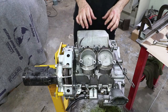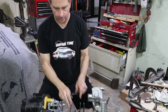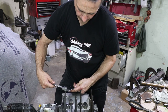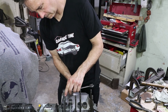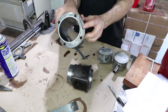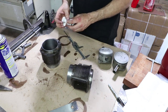This side right here is slightly high, so I have to take this all apart and determine why. I noticed one cylinder was hard to get on and off — I found out one of the head studs was a little bent, so I'm replacing it with an extra one I had, and that might help it sit flatter. This cylinder also has a broken fin and I did not do that torquing the bolts — this is how I found it. It probably got dinged when the head studs were bent.